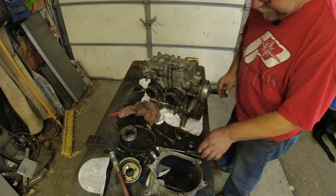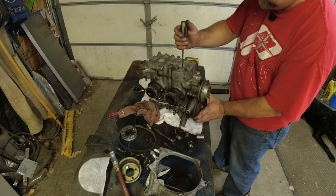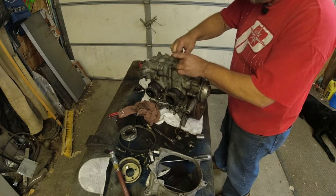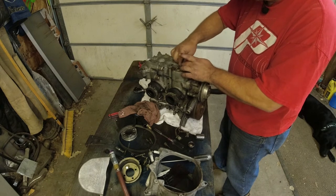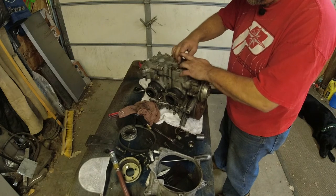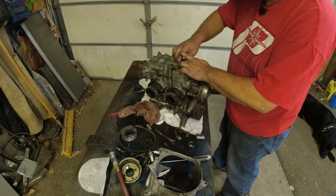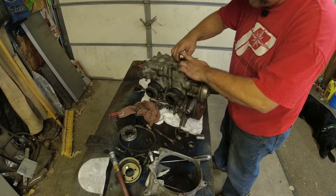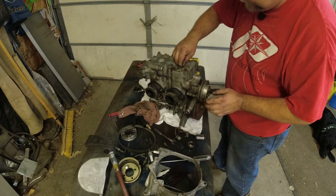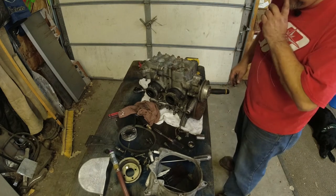Here's how I do the flywheel. I use my top dead center finder, running the engine backwards, just below TDC, and I just stuff a rope in there. I'm not going to bend a rod, and I'm not going to get the rope caught in the port because I didn't go down that far. That feels pretty locked in there.